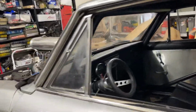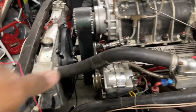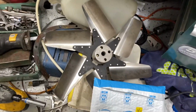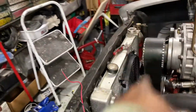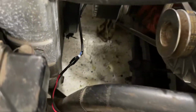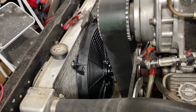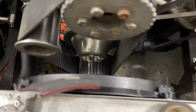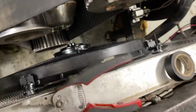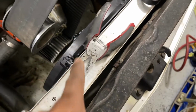As I told you guys, from the first drive, it was overheating, so I took the straight fan out and took the radiator out, removed the radiator. We got antifreeze all on the floor. Removed the radiator and mounted this electric fan. Very nice electric fan, guys. Powerful electric fan on here. I think it's 18 inches in diameter. This should cool off a whole lot.